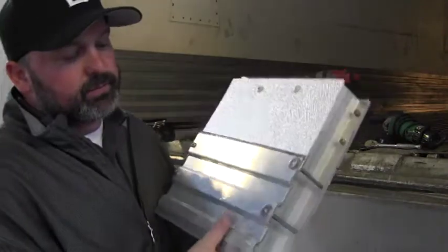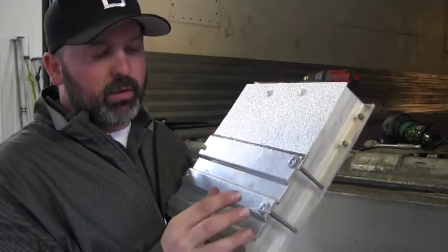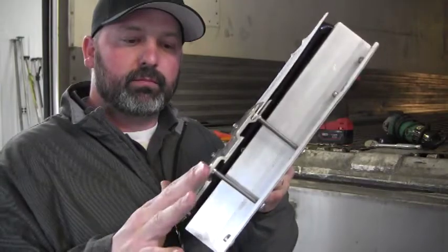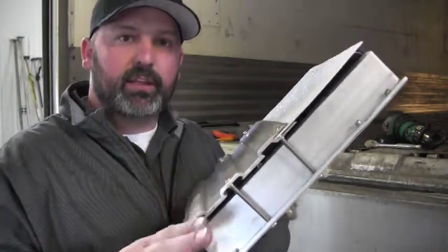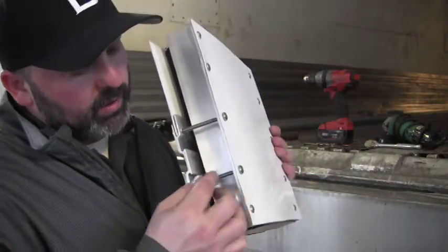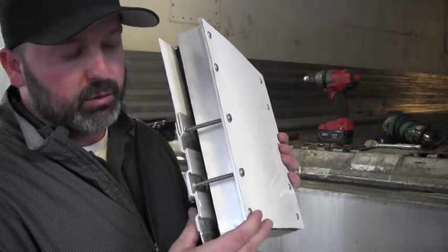On the interior, we use a brad hole T-nut. The nice thing about this product is it gives us a 3/4 inch grip on the inside. For the most part, it's flush with the wear band, which will allow product to skim over the top of it. And it has a 5/16 depth thread, so it gives us a lot more gripping strength on the 1/4 by 20 stainless steel screw.